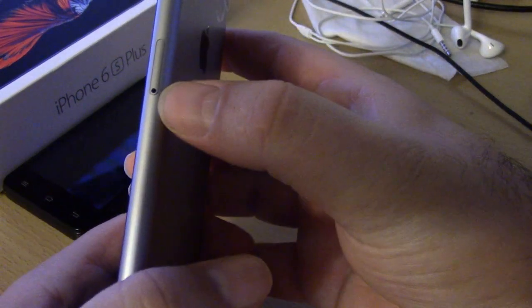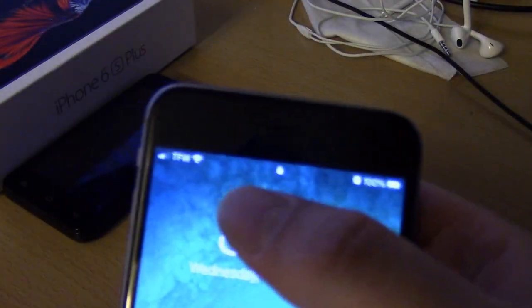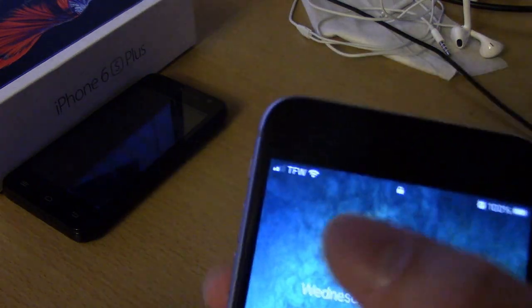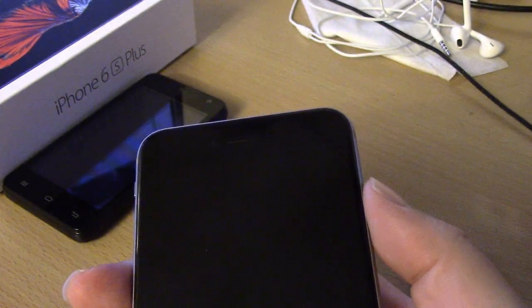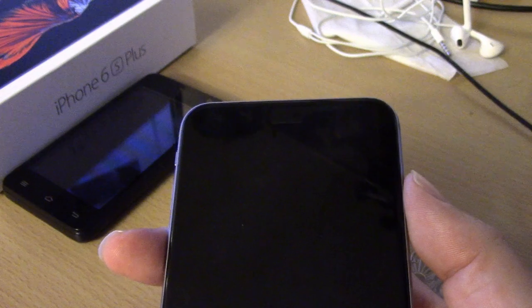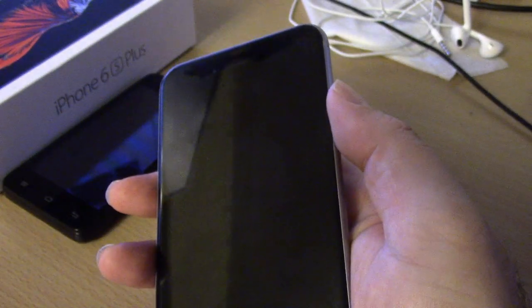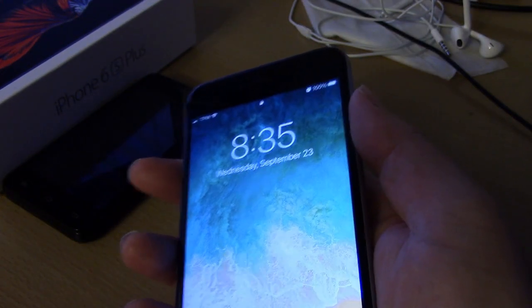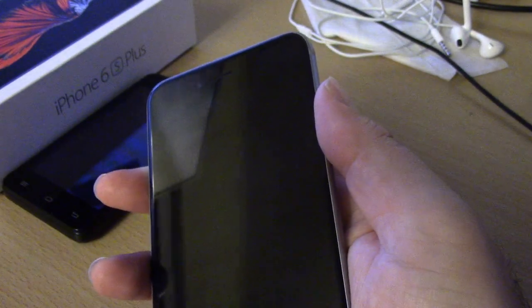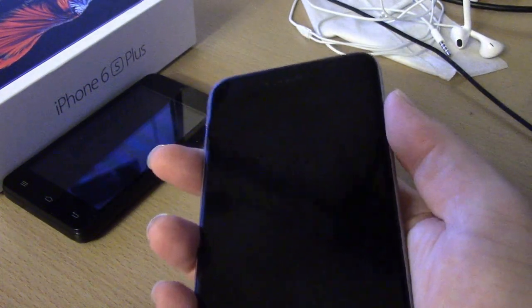What I did to fix it: right here where the SIM card slot is, I took out the SIM card and put it back in, turned off my phone and turned it back on. Then in the top where the network indicator is, it showed up. I went through the whole setup process again, put in my phone number, and it texted me back — I got the code and activated my phone. So if you're having trouble with SafeLink or any carrier — AT&T, Sprint, Verizon — try taking out your SIM card, putting it back in, and rebooting.